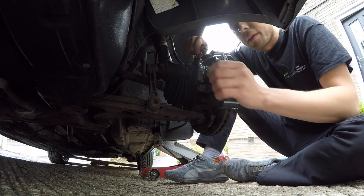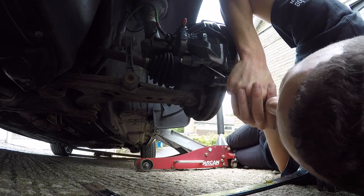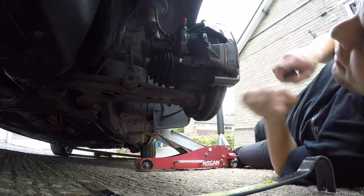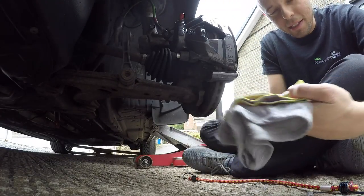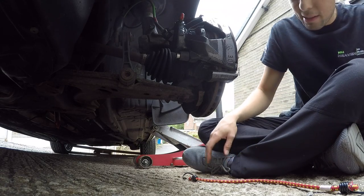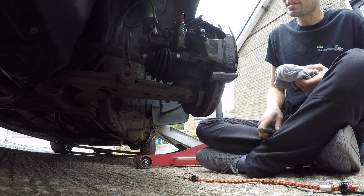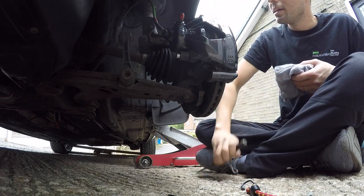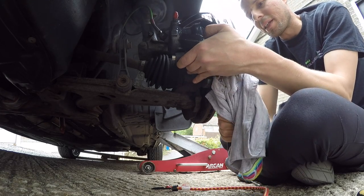Got to push them back — there we go, that one's coming out now. So that's out. Next I'm going to take off that spring thing — just click it out of there, take that off, and then we'll take that out. As I said in the past, old underwear — don't throw them away guys, as long as they're clean, you can use them. I know some people may laugh, but I'm going to use this chisel in there to push the caliper out, and then we'll bungee that up against the shock just so it's out of the way while we deal with all this. Yeah, it's coming out — you can tell they've been in here for a long time.